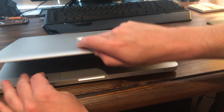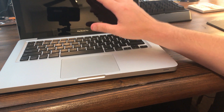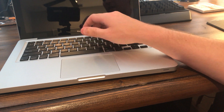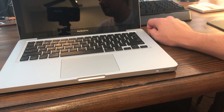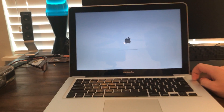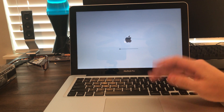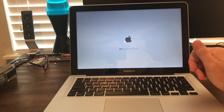It's a little bit heavy — I think it's like five pounds — but it's honestly beautiful. You can see the screen's in perfect condition in this case. The keyboard's great and it is backlit. We'll go ahead and just boot this up real quick so you guys can see. It is incredibly slow booting up because it is running on that 2.5-inch 5400 RPM hard drive, but we're gonna fix that today.